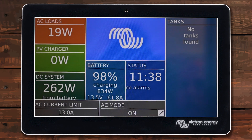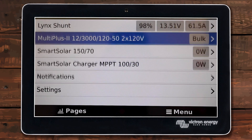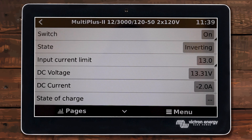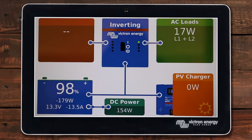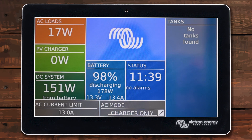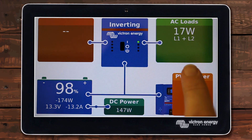Now that I know the load is low and I have this set to on to keep my router going, I'm going to go ahead and disconnect my shore power source. We can see the same information in the menu — it's disconnected very quickly, there are no voltages coming in, and the inverter went into inverting mode fast. On this screen we now have no shore power, no watts showing — everything's blank with dashes. We can also see we're losing power out of the battery bank with negatives showing, but the inverter is still on and we still have 120 volt power. Normally with solar panels this small load would keep the battery charged while going down the road.